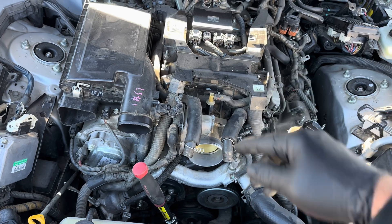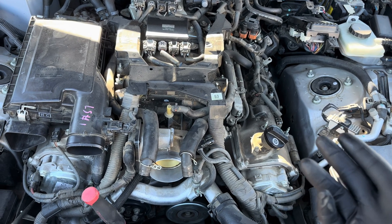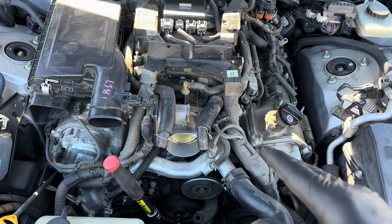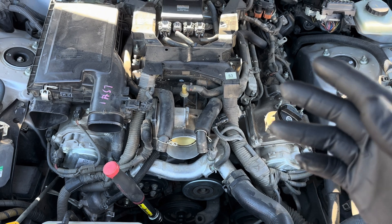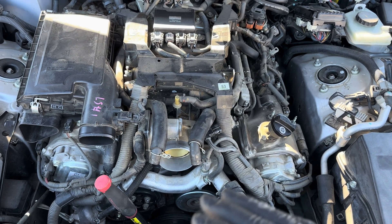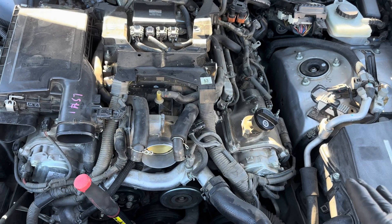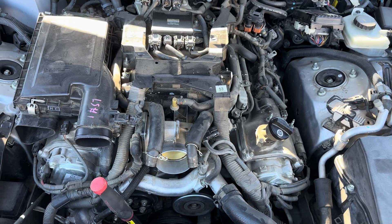From the inside of the intake it's really clean, besides a little bit of oil getting past the PCV, which is completely normal for every engine — even with a catch can it still happens. Everything looks pretty clean inside the engine. The problem is fueling, and it's a common problem with direct injection engines. We also live in California and the fuel out here, with all the ethanol and additives, just leaves carbon over time. It's supposed to be a cleaner fuel, but it uses more because of the alcohol content which has less BTU stored energy than standard gasoline. Let's go ahead and put this back together and run the product through.